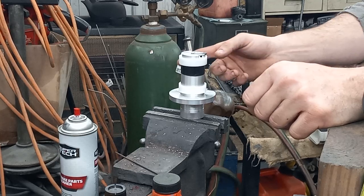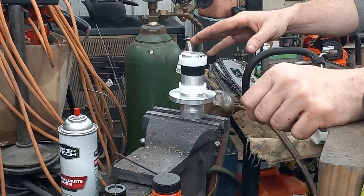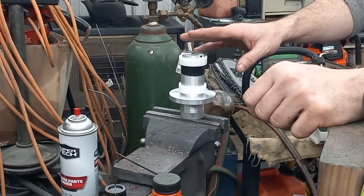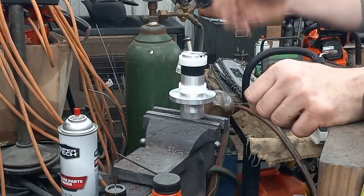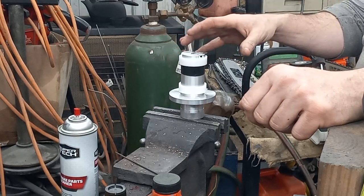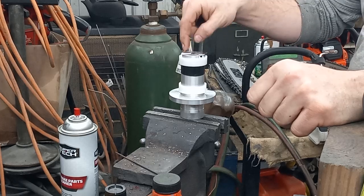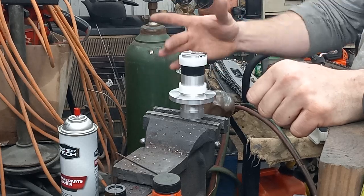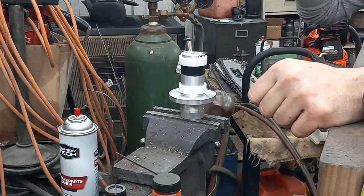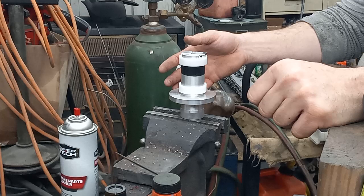As far as a safe and effective way, what Joe came up with here has been done before. The tooling in a mandrel has been done for a long time — I know a lot of builders that do it. But what Joe came up with is instead of having 15 or 20 mandrels, you have one mandrel with these nice adaptable sleeves. It takes up less space, less machine work, and you'll have less money into all the materials.